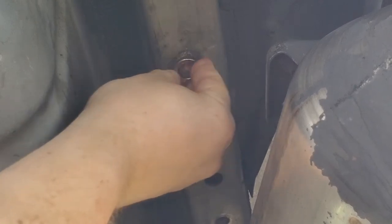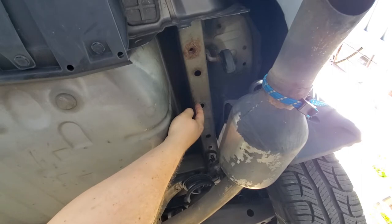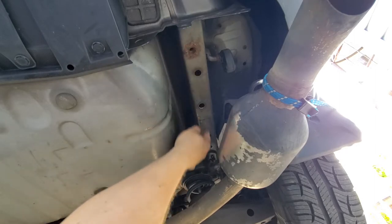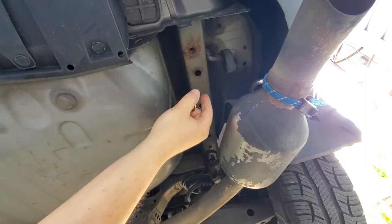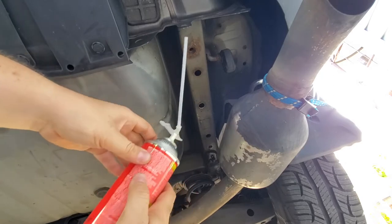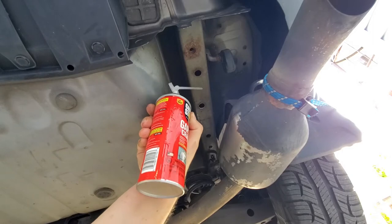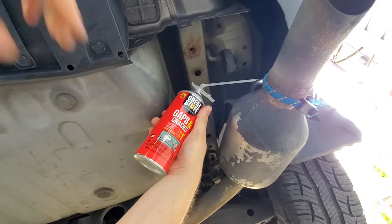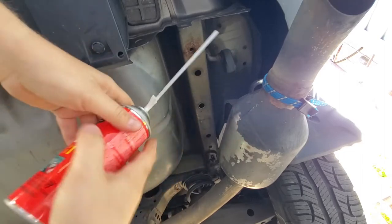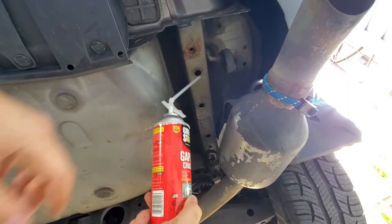Our rivet fits perfectly in the hole now and it's not going to move around — we made a perfect hole. Now, since we pressed the bolt with the original nut inside, it's just going to live in there forever. The problem is it might rattle back and forth inside the frame. To prevent this, use regular gap/crack expanding foam — shoot a little in where the bolt is located to secure it. If you don't have expanding foam, you can use silicone. Don't miss this step, because the thing is just going to constantly bounce and roll inside making all kinds of noises.